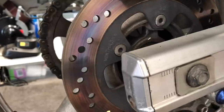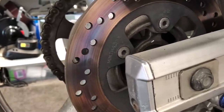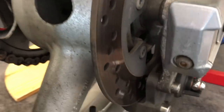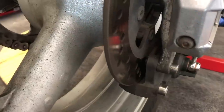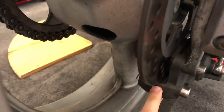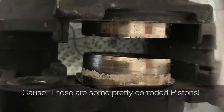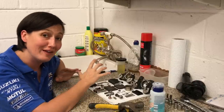Those discs have changed color rather dramatically. When I got home yesterday they were too hot to touch, and when I move my wheel it doesn't flow freely, so I think the brake pads are sticking. I've been having a little bit of a disaster with my rear caliper.